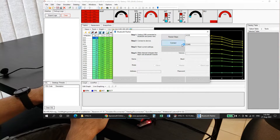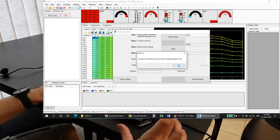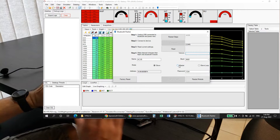A dialog pops up, so hit Connect, then hit Read. It's probably going to say no version detected — fail to read version from HC-05, which is fine, just hit OK. It will also fail to read password, so it's setting the default password to 1234, because out from the factory these chips are not programmed. The name is also set to default. So everything is defaulted because it's a brand new chip and nothing has been set yet.